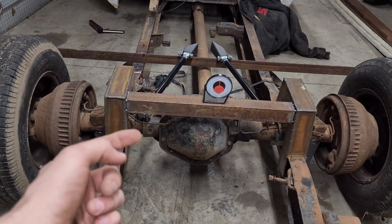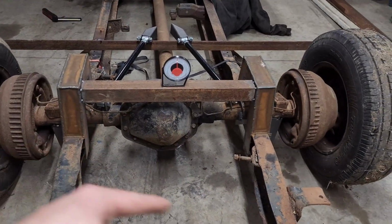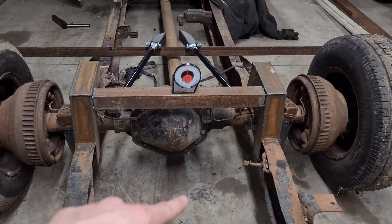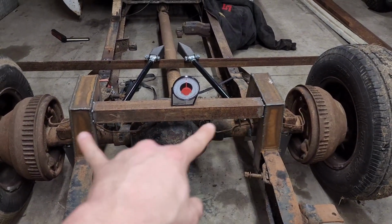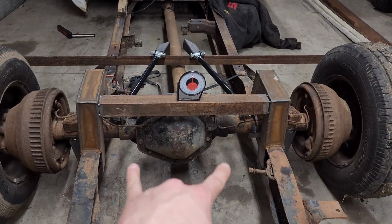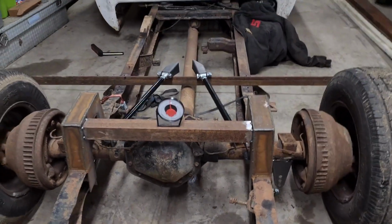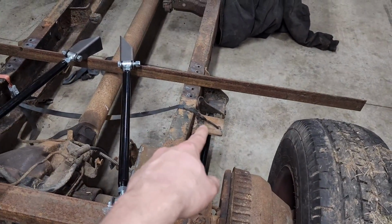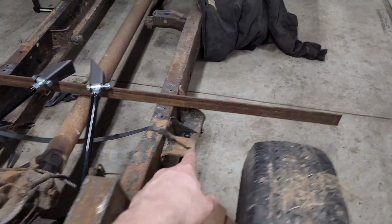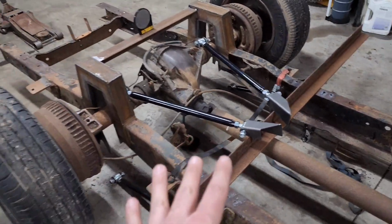So I'm going to weld brackets out. I'm going to put a plate there and then put some grade 8 bolts, and then I'll put the other arch here, and then I'll just do rear mount bags, and I'll put my upper plates here when I put an actual cross member support on here, and then I'll put the lower mounts down there, and it'll just be a rear bag setup. I'll have plenty of room up here. I'll have my 4-link bars, the lower bars using the factory shackle mounts, saddles, whatever you want to call it, and it should be good.